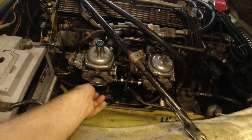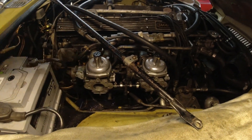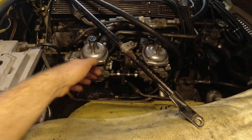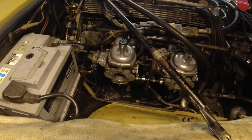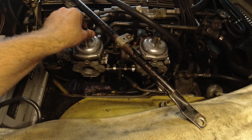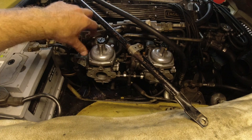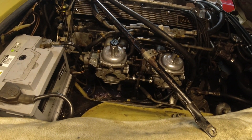What I was doing with my finger is basically the same thing you do with a screwdriver or with the lifting pin on an SU. Because if you lift the piston and it immediately dies, you are way too lean. If it just rises and rises and rises, you're too rich. If it goes up and then down again, you're pretty good. We're going to check with an exhaust gas analyzer later, and check timing. I mean, there's a lot still to do. But I just want to see that we can sort of get these working. I have about half a turn left to lean them out, so I'll try that and see if it makes a difference.